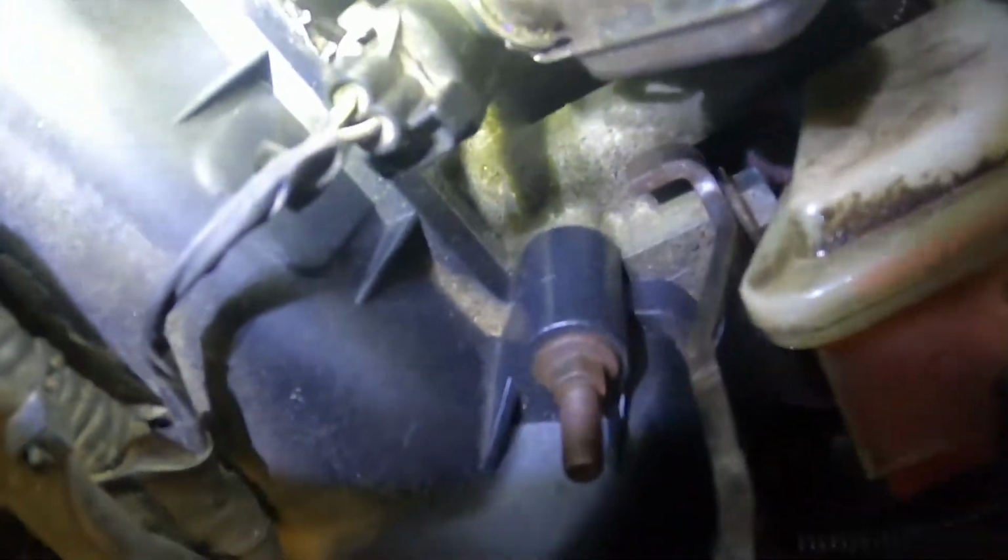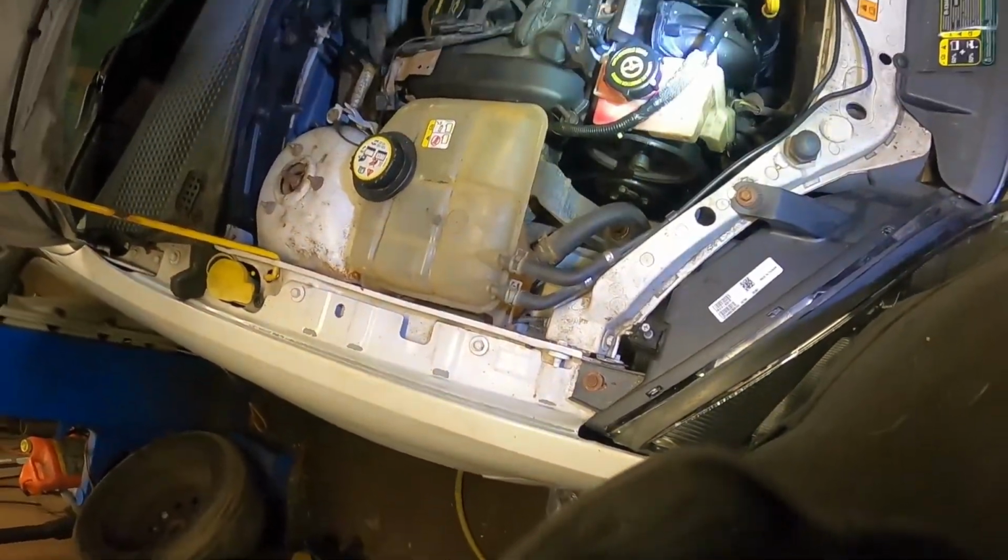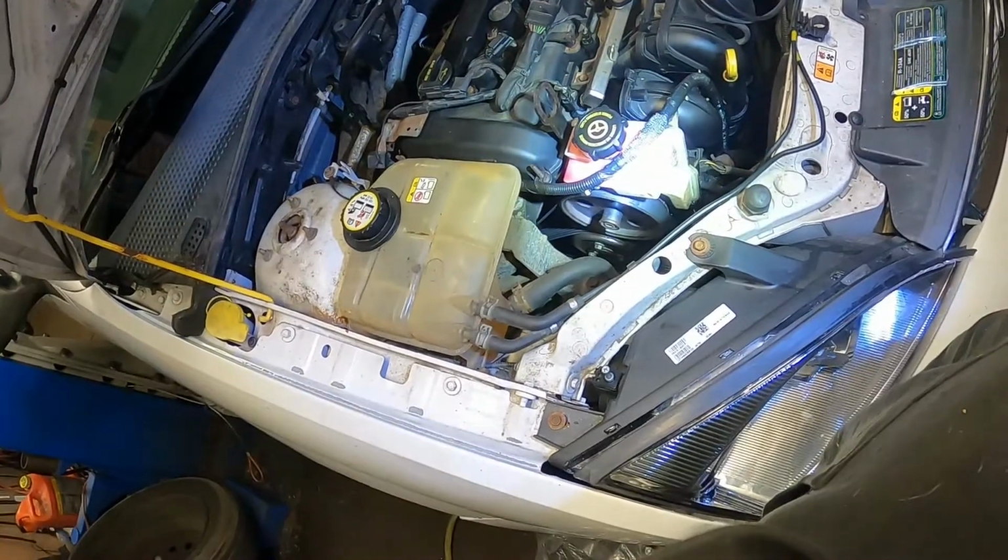I've kind of showed this to you guys. Usually it's kind of hard to find a power steering leak. I don't know if you guys ever had that. They're just oil caked on for forever. But I don't know if I can show you. Yeah, I guess you really can't see. Well, on the back side here, here we go. It's just pouring out of there. So there's a bad seal or something in this pump. So we know we need a pump. So let's replace the pump, guys.